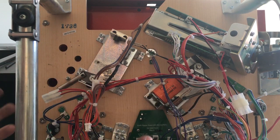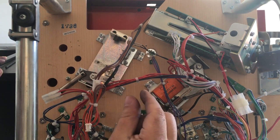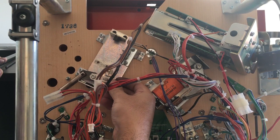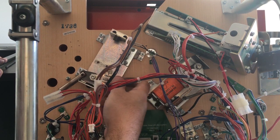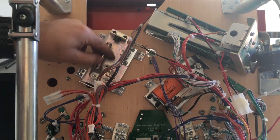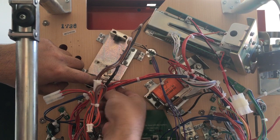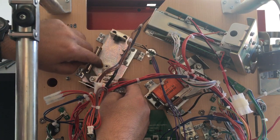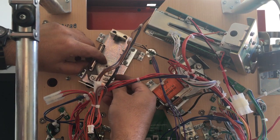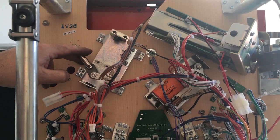One thing that I want to share with you guys, because I have 20 years of experience with this, you have to give it 1 millimeter, I don't know in US measurement, but in Europe, 1 millimeter of space. So this one can go in and out, okay, in the axle here. And then it will just move freely. And it's so important that it moves freely, because if you just make it flush all the way in and then tighten this one, then it won't move freely. And this is for all assemblies. So it's really important that you make sure that you have 1 millimeter of gap. Okay. Read the manual, guys. Read the manual.